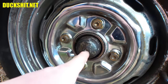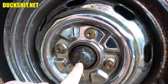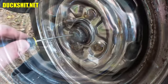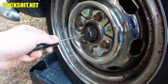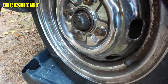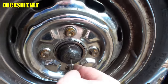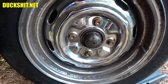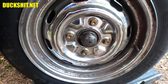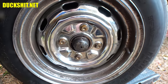Hopefully I'll get it aligned with this little square hole. If you try to push the cable in and it's misaligned, of course it's not going to go in — it could be a little bit fussy. I'll push it right through. Hopefully this screwdriver is small enough. I might need a thinner pick. The cable on the back side of the spindle might be jammed, and that can be a problem sometimes. But usually if you get around the back side and just start pulling on the cable, you can just rip it out. It's only held in by friction and years of dirt and grease — it kind of glues it in place. Otherwise it's not mechanically held in by any clips.